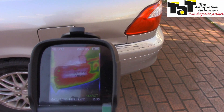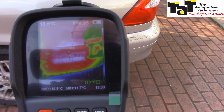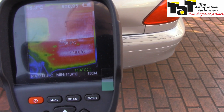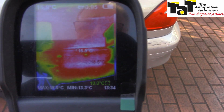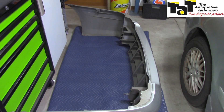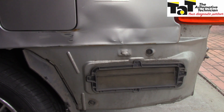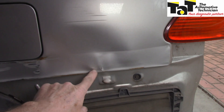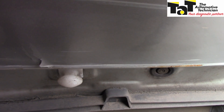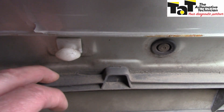This has been a bit hard to find simply because of the location of that vent — it's in behind the rear bumper itself. But you can see there's definitely a hot spot there. We're measuring about 18 degrees; I had 20-something degrees there before. You can see just above the bumper, and if we come back there, you can see just above it and below it, the white leaching out. I've taken the bumper bar off to see if I can find that leak. And are you ready for the big reveal? It looks like a semi rolled into the thing or something, and it's actually dented this area here — and down here as well. It's actually folded in just here, and of course the water's going to travel down and dribble down the bottom. So I'd say that this is the problem here.